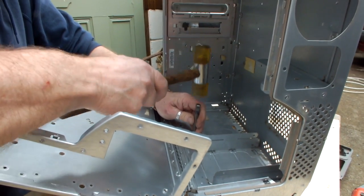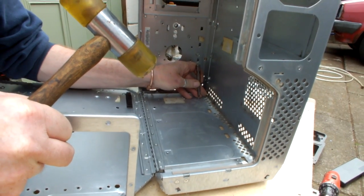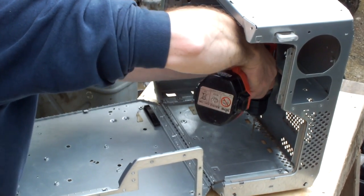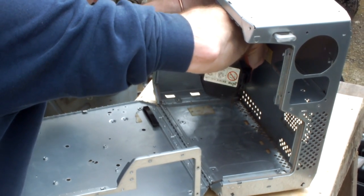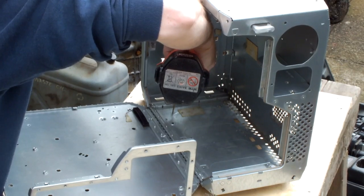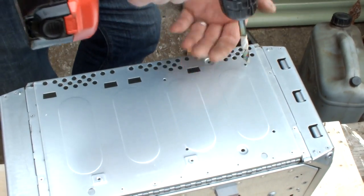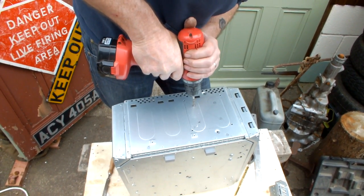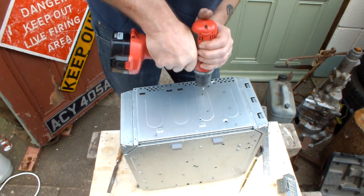This next section was not instructed by the LaserHive. Cutting out that little shelf is also something you do not need to do to fit an MATX board in the system, but it's a modification I wanted to do desperately. In terms of cooling, this case is not the best - it's adequate for the G4 hardware but stuff runs a lot hotter these days, especially a 4770 and a fairly beefy video card. I wanted this system to look stock from the outside, so my only option for drilling completely new fan holes was to do it in the bottom of the case. That's exactly what I did - towards the front of the case, not obstructing the main hard drive bays at all.